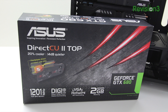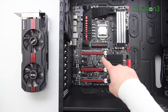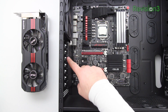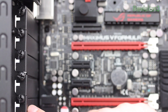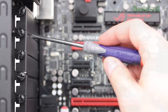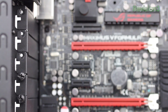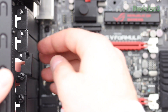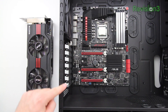The next thing to do is install a couple of graphics cards. Here we're looking at the mega powerful ASUS Direct CU 2 Top Edition GTX 680. There are two of these and they're gigantic triple slot cards that are going to install into the expansion bays at the lower portion of the motherboard. I've got these plates on the back of the chassis that need to be removed — in fact I've got to remove all of them. You can use either a Phillips screwdriver or a flat head to remove these screws. Once you loosen them a little bit you can use your fingers to untighten them. Loosening these plates and removing them gives you access to the ports on your expansion cards — your graphics card as well as your sound card.